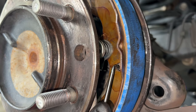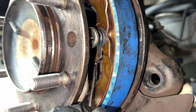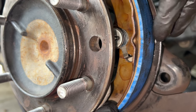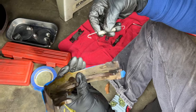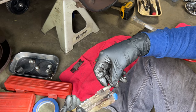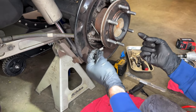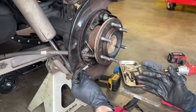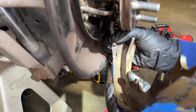I still have to get the back plate into position with the hook into the hole, so I grab the hook of the plate with my 90-degree pick tool, put my thumb on the spring assembly so it doesn't slide out, pry it up, and put it in position. The spring assembly is now properly installed onto the rear shoe. Now I want to get the bottom return spring in position on the rear shoe — I go behind and hook into the shoe. It's a little hard to see with the camera because it's tight in there; I could have attached this to the shoe before rotating it into position, but it's not that hard to get started.